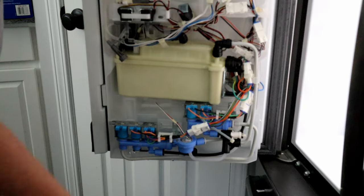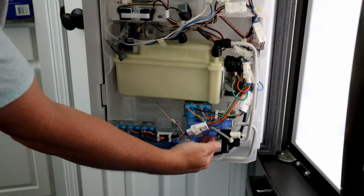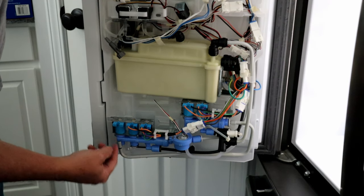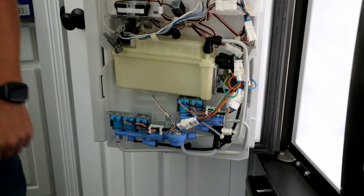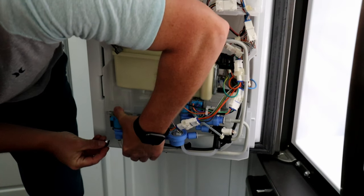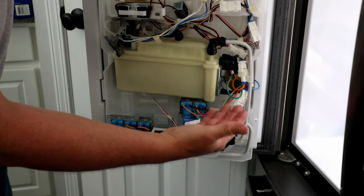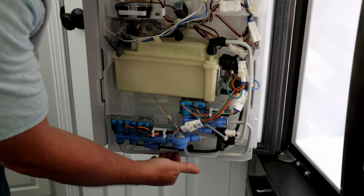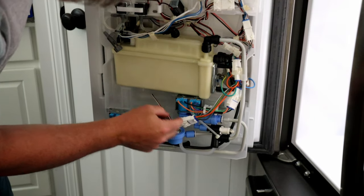So we know the water is coming in from our isolation valve, which is actually under the refrigerator, coming in through our supply line through this metering device. We know we've got water from there — that relay works. Now we follow this pipe up to this double valve. I'm going to put this line back in. It seems to be activating the relay when I press start heating. So we know the water flow is good from there. We're going to follow this tube up into our double valve and find out which valve is activating for the Keurig.